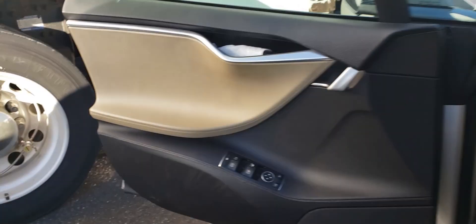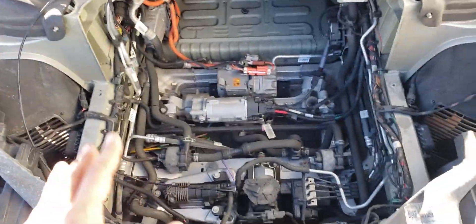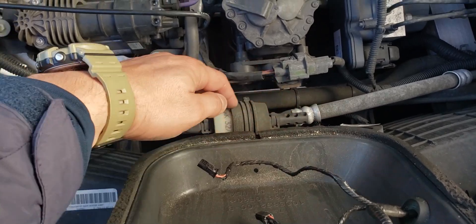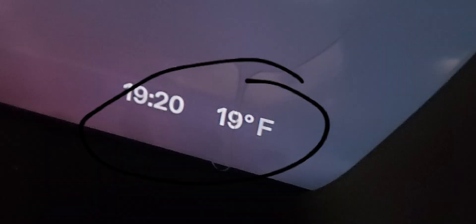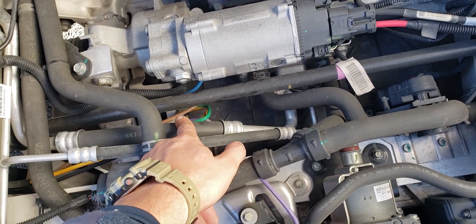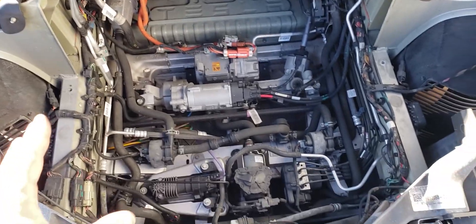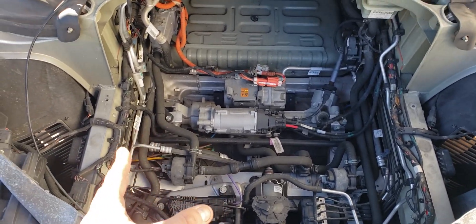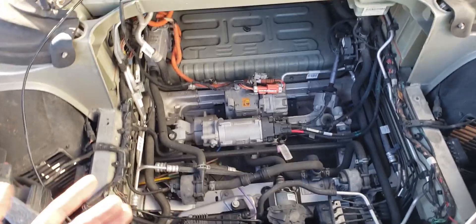My theory on what happened: we drove from Florida to Illinois. There was a leak before, so the system was sucking in Florida's humid air, filling the tank and the whole suspension with humid air. When we came north and it got really cold, I think the solenoid block just froze up — every single shock is controlled by that block. If your car drops to the ground, get into a heated garage and try putting a hair dryer on that block. Today, only two days after fixing it, it started to raise up again and it's about 50°F today. So they do freeze.